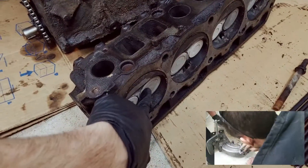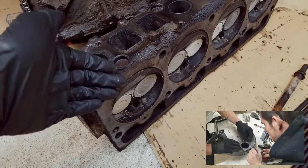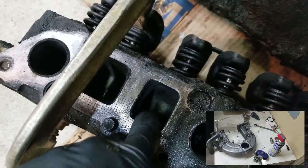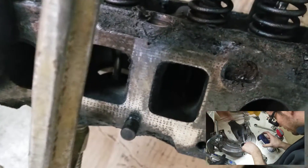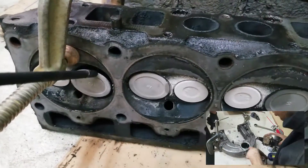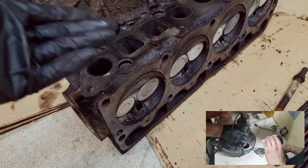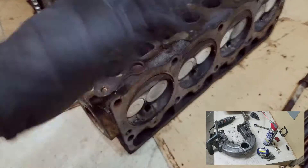The length of time that this valve is open, as well as how far open it goes, is what really controls the amount of air that goes into your cylinder. The air comes from that manifold, enters in here, goes right out the valve, right over the top — out of this hole right here and entering into your cylinder. So this gap is what is controlling that amount of air flow. I've had people tell me that by putting on my 4 liter throttle body, I'm going to be adding more air to the system, thus changing the fuel to air ratio.